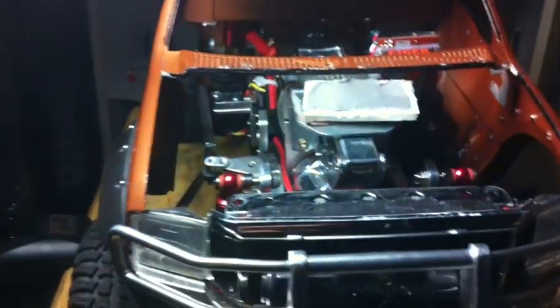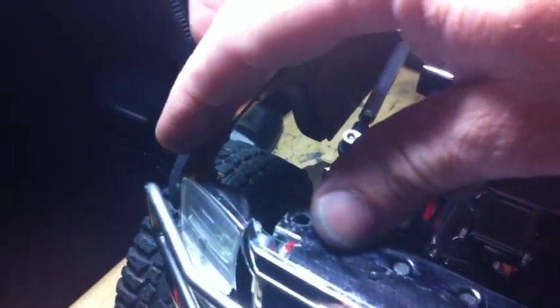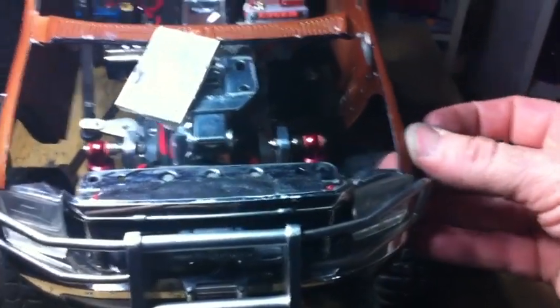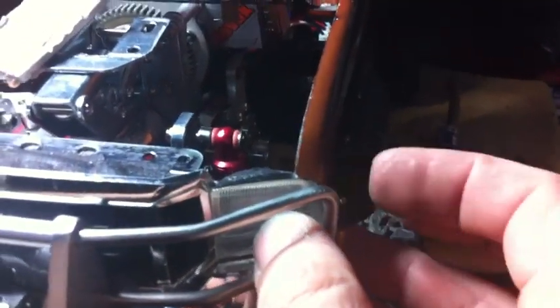I still need to put some mounts on the inside to bring this in flush. Overall, once everything is set in the right place, I'm going to put some aluminum braces just off the one bolt hole — make a little 45-degree angle, bring a flat piece of aluminum over, and bolt it right to the hole here. This piece of aluminum will hold this fender, and I'll do the same on the other side going down, mounting onto the fender into that hole to keep the whole thing nice and tight and flush.